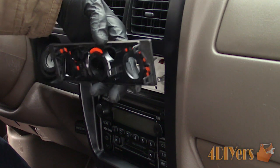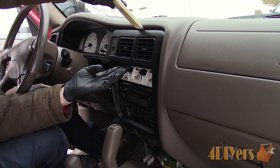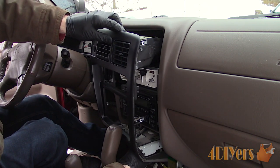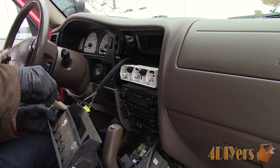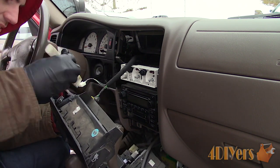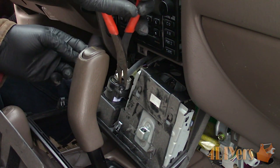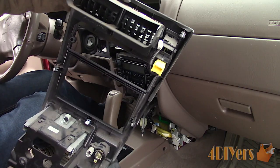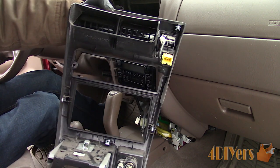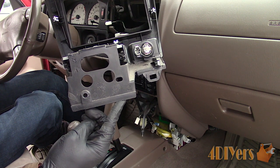Here's a view of the back side. Remove the two Phillips screws hidden behind the HVAC panel holding on the bezel. Using a nylon trim tool, carefully pry around the radio bezel — you can start at the top or bottom, it doesn't really matter. There will be various clips around the trim, so take your time especially in the cold as you can crack the plastic. Disconnect the plug on the rear for the passenger side airbag — this has a yellow connector with a spring-loaded locking latch that needs to be pushed back when disconnecting. Disconnect the cigarette lighter at the bottom, then remove the light in the ashtray which pulls out.